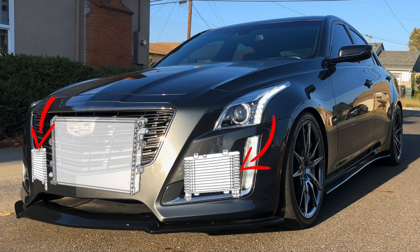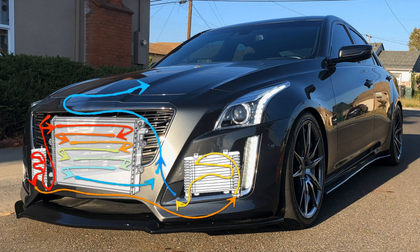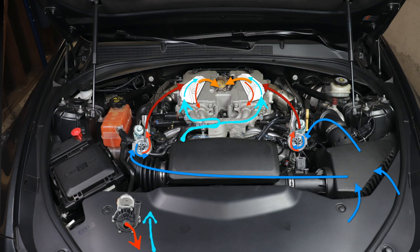The V-Sport has two auxiliary coolers on the sides, but from what I can tell, they are there to support the main engine's coolant — separate system. The XTS V-Sport doesn't even have these. The ATS-V, however, has the coolant flow through a front-mount intercooler, but that coolant also splits off to two similar side auxiliary coolers, and this leads me to believe that the ATS-V probably has better intercooling capabilities. But if there are bubbles in there, it will inhibit heat transfer because air doesn't take on heat as well as coolant does.